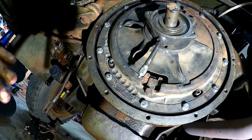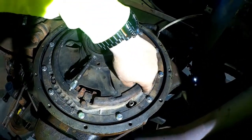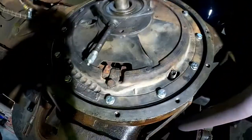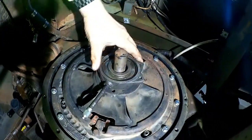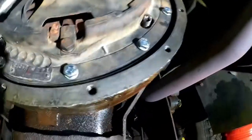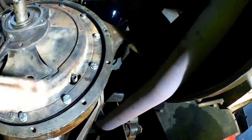I installed my ring gear after I had it turned down and polished. Also had my pressure plate face redone. Put that back together — basically to do that you just pull these four springs and your pressure plate face drops right off. Install the new throwout bearing. Right now I'm using a pilot to line up my clutch disc so when I put my transmission in it's all lined up. Make sure your adjusting disc is turned so it's about half an inch, a little bit less than half an inch from the facing — in and out from the facing — so you don't have to keep coming down here and readjusting it because you put a new clutch in.